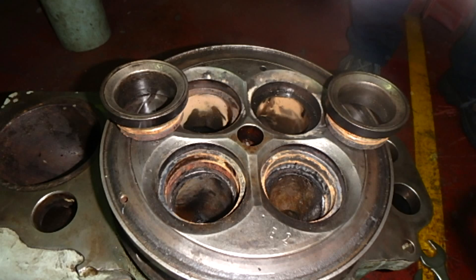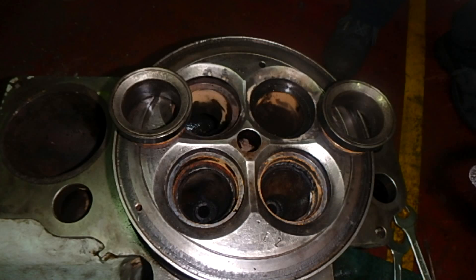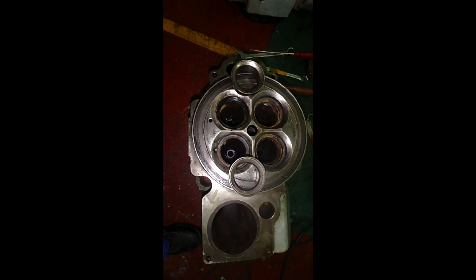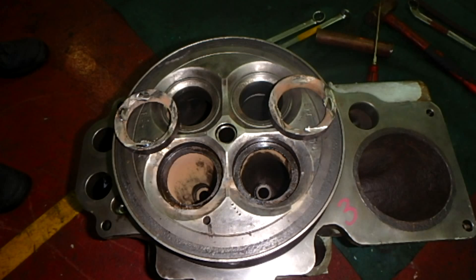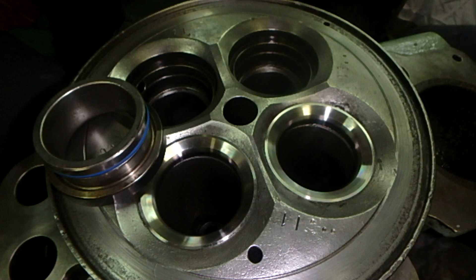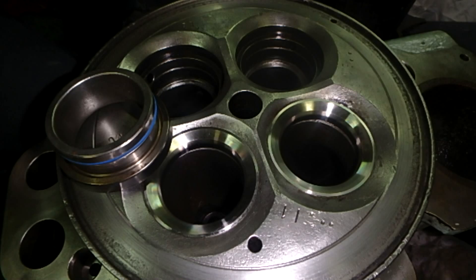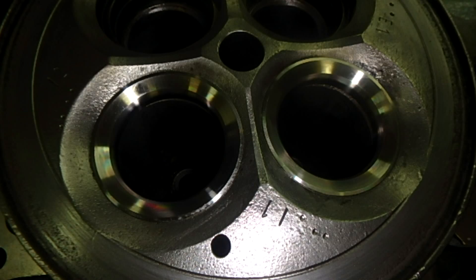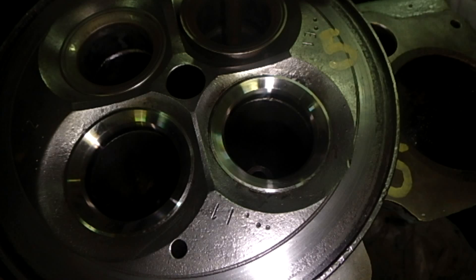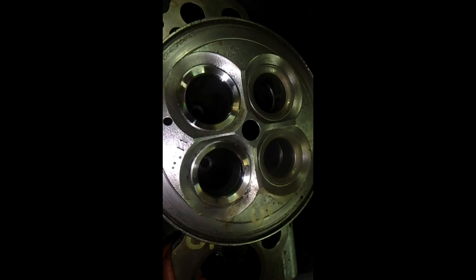In most cases, after 16,000 hours of engine operation it is certain that some parts will be replaced. All O-rings and flame rings are better replaced — do not economize on these, because this is your generator, the engine that provides power for the entire ship. Here you can see the O-ring of the exhaust valve seat. When we make the pressure test we find a small leakage from the exhaust valve seat rings, so we apply a compound from the Loctite brand which has a sealing effect.